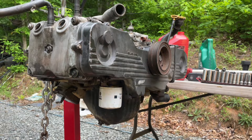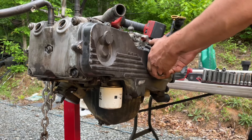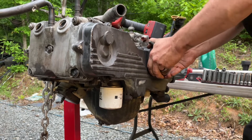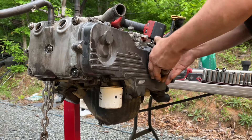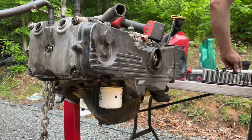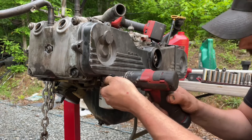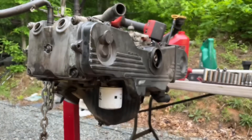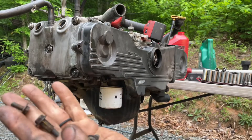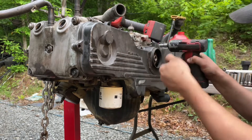Let's get this timing cover off here. This thing just pulls off by hand. If it's on there a little tight and you think you need to pull it, you don't — just keep wiggling. Maybe tap it with a little hammer, but be careful because it's kind of brittle. These are 10 millimeter and they're all pretty much the same. There are two different kinds of bolts that go on these timing covers — one doesn't have a shoulder and the other one does. There are about four or five of one kind and about ten or twelve of the other. I just know this one so well because I've done it so many times.